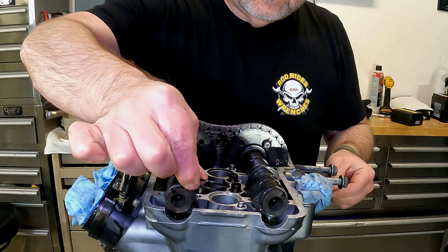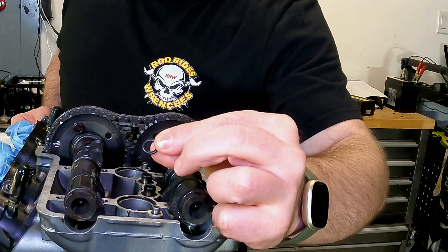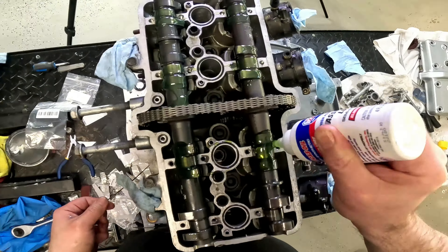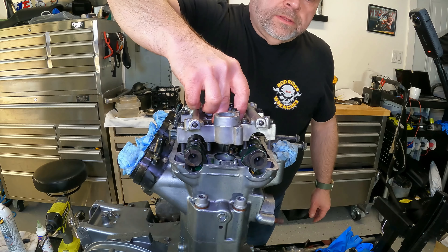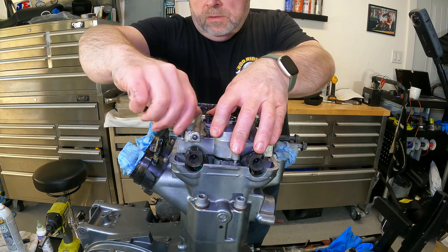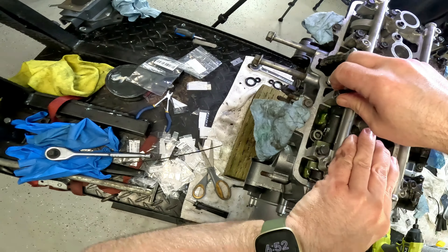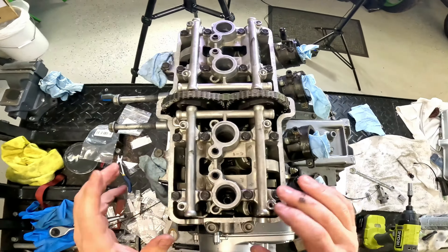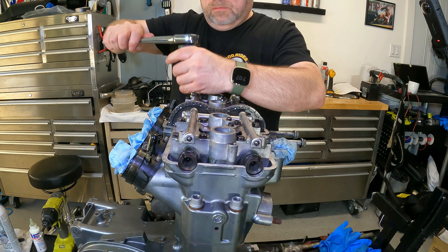Satisfied with the timing, I'm replacing a few O-rings now in the cylinder head — these large ones that go around the spark plug hole and these smaller ones that are in oil passages for the cam keepers. With lots of assembly lube on the camshaft lobes and journals, I can now tighten down the cam keepers. These keepers can only be installed on their respective sides of the engine they came off of, so be sure to double check that you have them in the correct position before bolting down. The keepers might be a bit awkward at first to install since the cam lobes will be resisting compression. Start by manually threading all the bolts into the respective holes and then gently snugging the bolts to where there are no bolt threads visible. Once that's done, I start torquing the bolts in the numbered sequence stamped on the keepers, number 1 through 16.